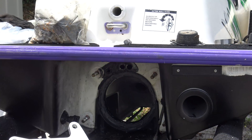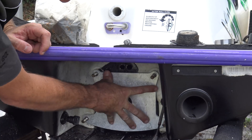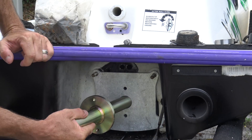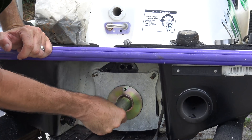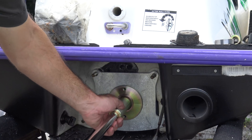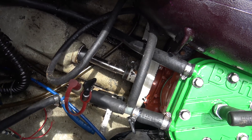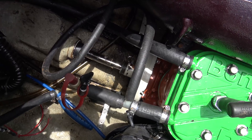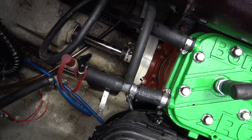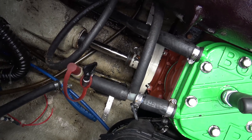On my SP here, plate C is what fits my bolt pattern. With your pump off, you put this plate on and bolt it on like normal. Make sure it's completely straight when you bolt this on. Once the plate is fastened securely, this piece goes in with the long end — it only fits one way. You screw this to the plate so it's flush against the mounting plate. Once those are screwed in securely, you take your alignment shaft, go in, and you want this thing to be in the PTO — like so. You can see it's in the PTO with my motor mounts loose.